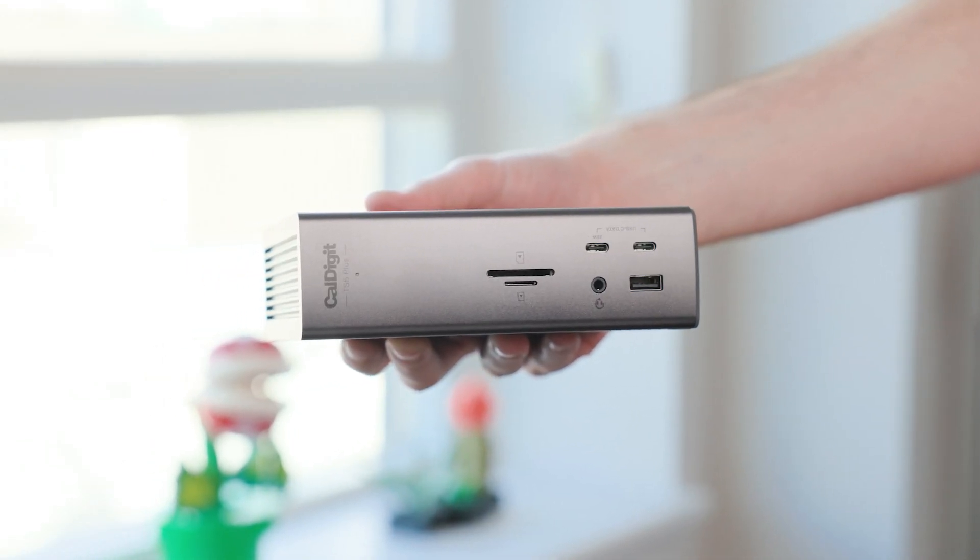Now, the TS5 Plus is a tougher call. If you do have a Thunderbolt 5 system, or you know you'll upgrade soon, the TS5 Plus gives you meaningful gains: faster USB speeds thanks to those dual controllers — my favorite feature — 10 gigabit ethernet for networked editing or other networked needs, higher charging capabilities for connected devices, and improved future-proofing with DisplayPort 2.1 and Thunderbolt 5 architecture. For professional creators, or anyone building a setup meant to last several years, that's a solid reason to upgrade. But for most current TS4 users, the performance you're getting is still excellent, especially since Thunderbolt 4 already supports 40 gigabits per second bandwidth, which is plenty for most workflows today.